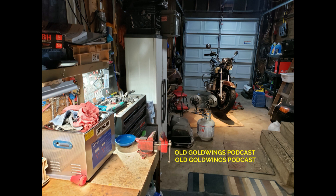I've had to call customers back and ask for the original high and low speed jets because the aftermarket ones were either not the correct jetting — causing bad performance all around — or they had small burrs from bad manufacturing and collected particles of debris. It didn't take much to clog those up and cause a problem. The cheap ones are a bright gold color compared to the dull brass color of the originals.